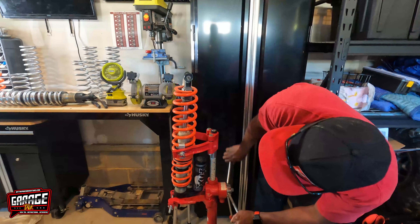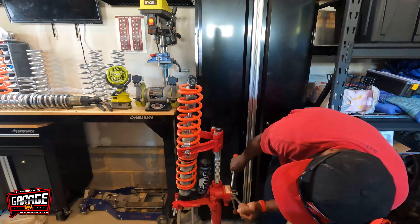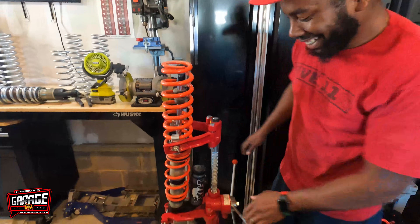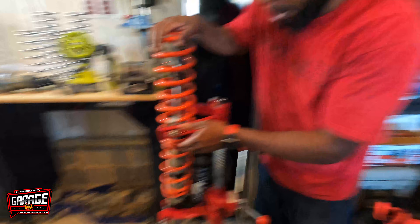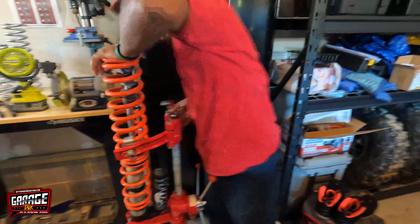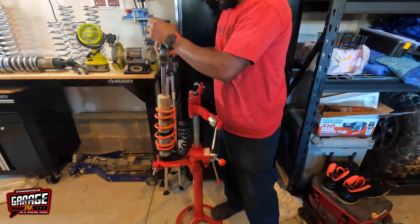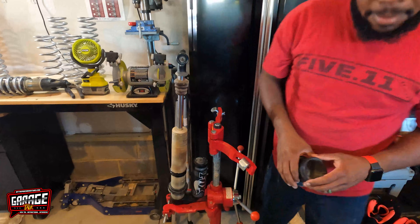It's like a wake-you-up moment for that bottom spring! All right, so now we've got to loosen all this up and take it off. Let me get my hand on this — y'all sit tight. All right, that should go. Now we go ahead and pull it off. We'll take some measurements: remember three and a half for preload and then seven for the collar. Let's go.